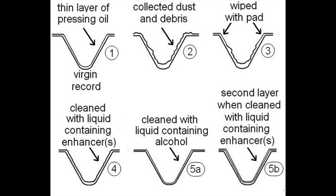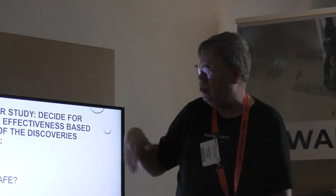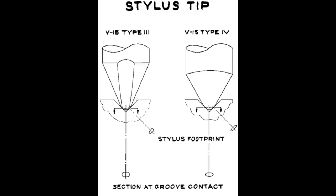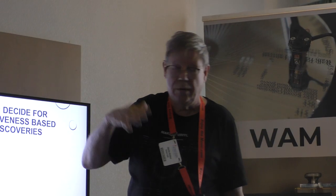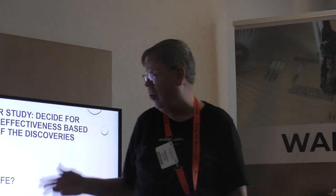And I did not know this 11 years ago. I found this document that I showed earlier 2 years ago. Yes, indeed, they had a problem. And so in 1978, you even go on the Shure archive site, they provided you with a brush with the cartridge. So you remove whatever the needle is gouging out, so it doesn't get onto the cantilever and so on.